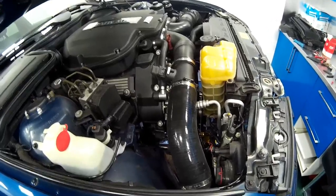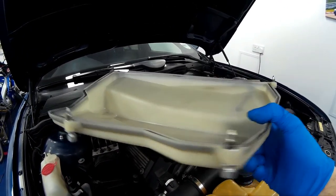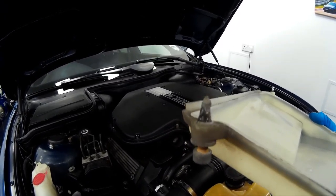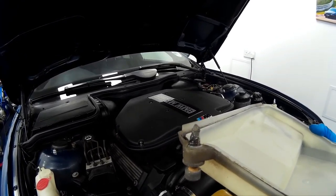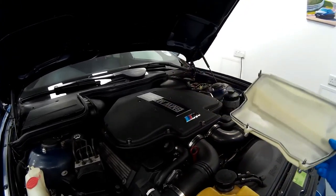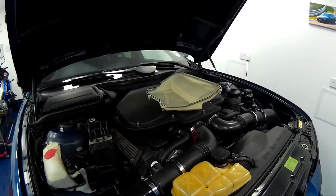What's left to do: put the ECU lid back on. I've popped a bit of grease around the threads and on the one directly below the bonnet hinge, as it's quite corroded due to sitting under a water trap. I've made sure there's no chance of any water accessing the ECU system — it was bone dry in there — and popped a bit of grease on there as well so when I put it back on in the future and want to take the M6 bolts off, I'll have no issues.